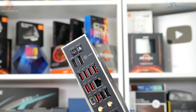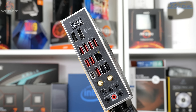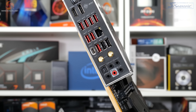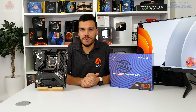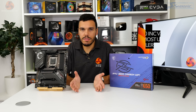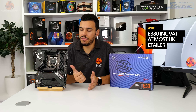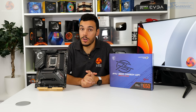The key downside is that you're likely to miss out on front panel 20 gigabits per second USB Type-C if motherboard vendors choose to put the single port on the rear I/O instead. That's a summary of B650 versus X670. Clearly, if they're the same price you'd probably want X670, but there's more to it than that because motherboards have different features from their vendors. So let's take a look at this premium B650 non-E offering.